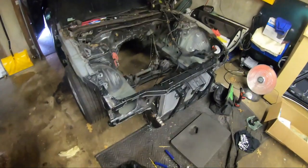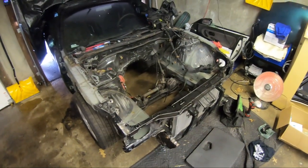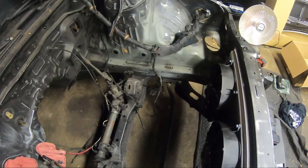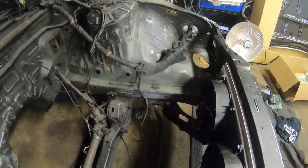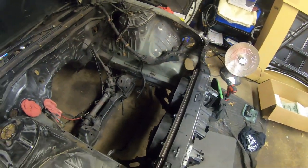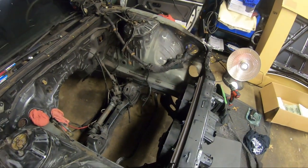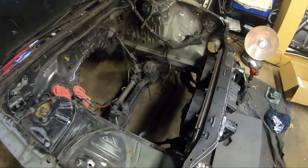I ended up cutting the rust out to a decent shape so I could weld in the metal replacement, welded that in, ground all the welds down, made it nice and smooth, put body filler over every single spot, smoothed it all down and primed it. It looks pretty good — I'm pretty happy with the final product. That took a very long time. I'm unfamiliar with body work so I just didn't feel like filming it. I just lightly scuffed up the engine bay — nothing crazy.